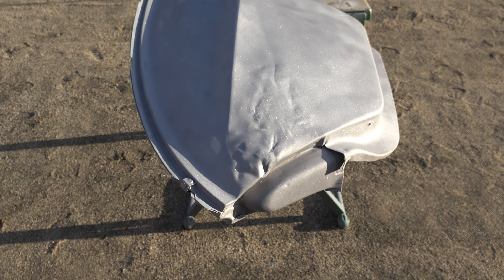With that disaster averted, I turned my attention back to the glazing putty. I began sanding the putty smooth on both the driver fender and the passenger fender. Once complete, I go ahead and check my progress by applying more filler primer — this time from a spray can. One area that was giving me a lot of problems was the body molding at the rear of the fender. No matter how I tried, I could not get this section looking smooth. This was primarily due to the fact that I didn't have a sanding block for this area.